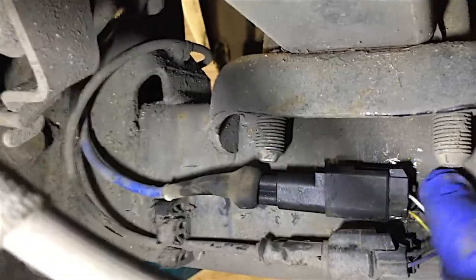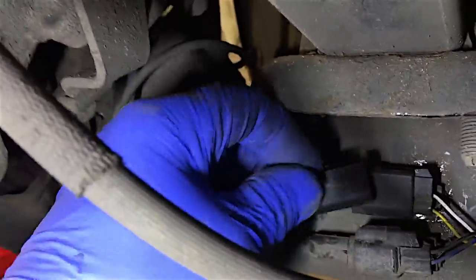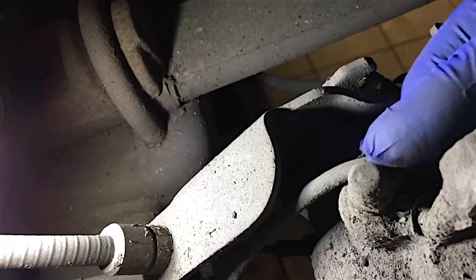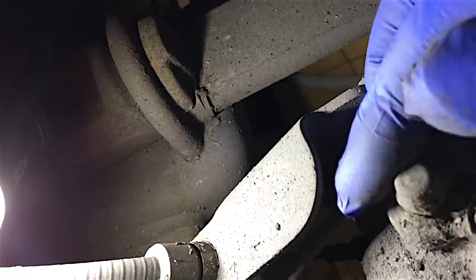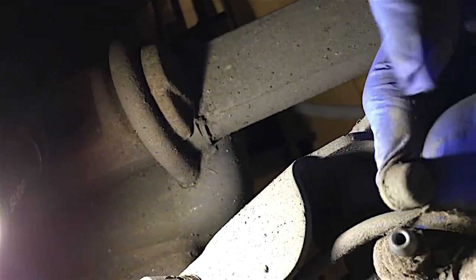There's a little clip in here — you push down and then you pull this. I've already undone it. Because it was a bit tight coming out, so you've got to be careful. The sensing wire we've just disconnected routes through the little rubber cap that goes over your bleed nipple on your brake caliper. So I've just pulled that cap off. Now we can remove that piece of wiring from there and pull that whole wiring right out.